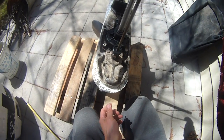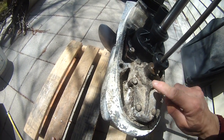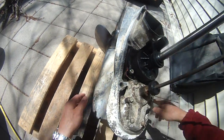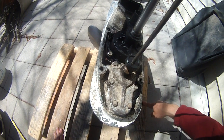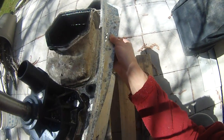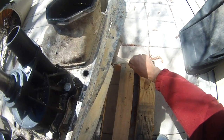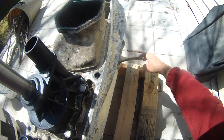So that's what I have for this motor — reverse, forward, and neutral. You can see the lower unit is working. When I turn the prop in neutral it can turn freely, but when it's not in neutral it won't turn, which is pretty good. Right now it's forward, so I can turn just a little bit, but when I push it down to neutral, the prop can turn freely.